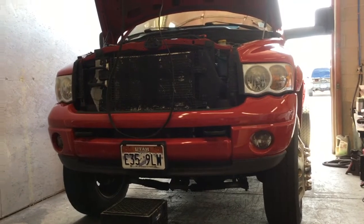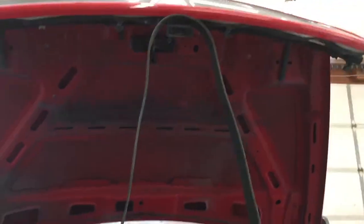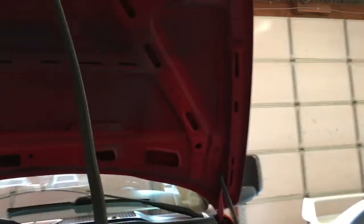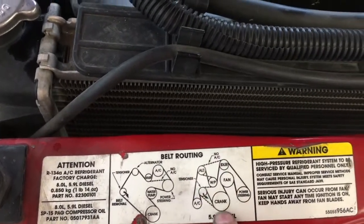This is the AC belt - as you can tell it's pretty big. I just pulled it off. I'll try to put part numbers in the description. This belt is like 120 inches or something - it's pretty big. What you do is pull that belt off, and then this is the key trick: right here on this little diagram you see those dotted lines - that's the belt routing you're going to use.